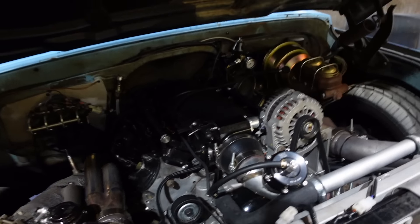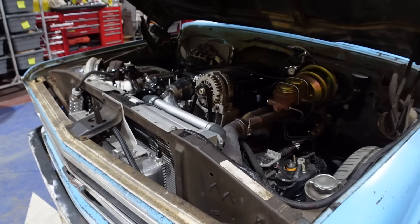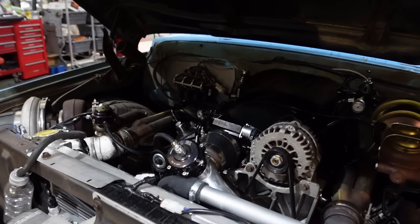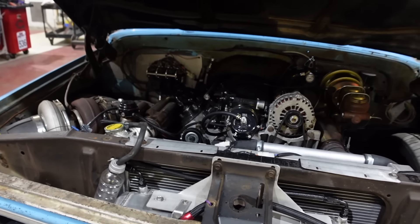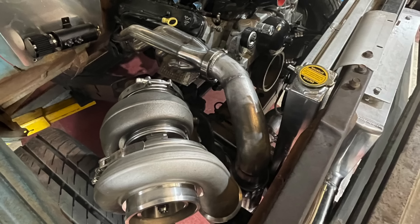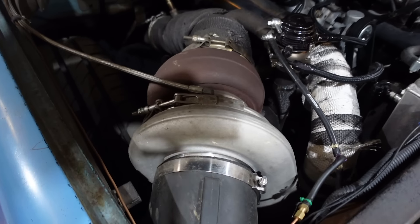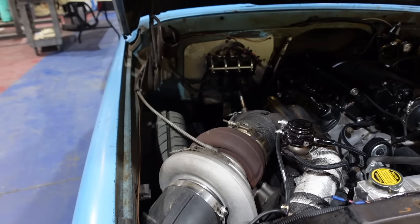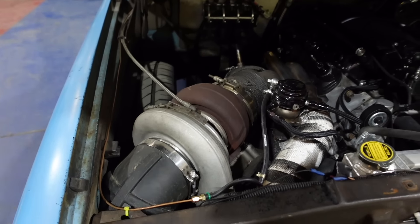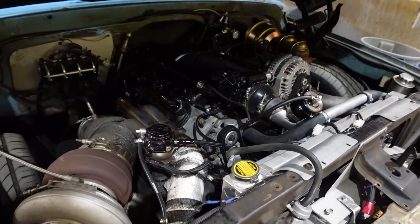I did rebuild the entire motor, which was probably the majority of the cost. I parted out the entire Escalade and got around $2,000 back, which covered the entire engine rebuild. I went through the whole motor — new rods, new valves, new valve springs, a cam from Texas Speed, dual valve springs, Melling oil pump, ARP head studs. Everything was rebuilt because I knew I was going to boost it, so I gapped the piston rings for boost. In the motor, I spent probably around $3,500 total including the cam, intake, and everything to get it rebuilt. For an LS3 aluminum block, I think that was a pretty good deal.